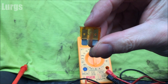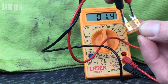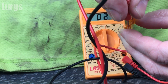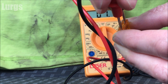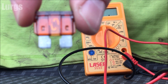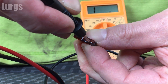Just to show you the fuse when it's out — testing a working fuse — you can see in the background the multimeter has a reading, this is a good fuse. Just testing it on the top; this is basically to show you how it works, it's a little bit clearer when it's away from the fuse box. And this is the blown one which I'm just going to test here just to prove it works — not that it's a theory, it's just real. And as you can see, no reading, and just to double check on those terminals — no reading.